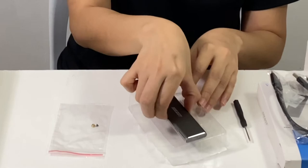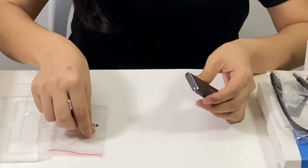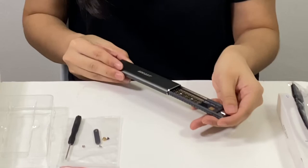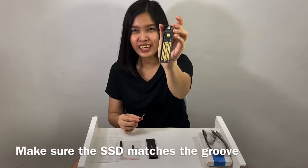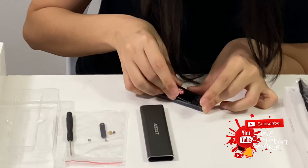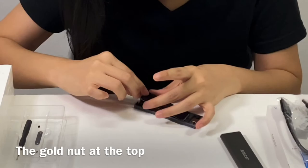According to the instructions, we'll have to dismantle the product first. After removing the screws, just press this gently. This is what it looks like inside the enclosure. Now let's get the SSD. Inside the enclosure, you will see a groove — that's where you will put the SSD. Make sure to do it gently and use a 45 degree angle. Using the included nuts and bolts, we will be fixing this SSD in place.